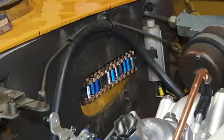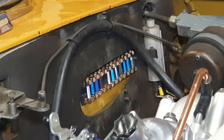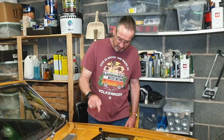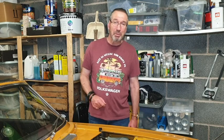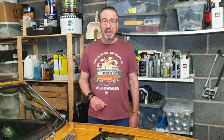All of the contacts have now been cleaned up and she's now running like a dream. As soon as I just wiggled this fuse up and down a few times, that was it — problem over, all sorted. So guys, that's just a short and sweet post, just in case that sort of problem happens to you. If you develop a misfire and the rev counter's going a bit funny, it is just as simple as a bad connection on your fuse. Until next time — hopefully up in Scotland — stay well and stay safe.